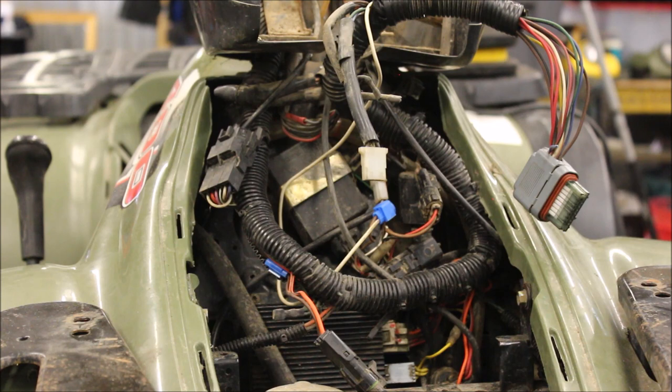Now you might be asking yourself — is this a good idea? The fan will stay running while the ATV is running, only on the key switch. As soon as you turn the key off, the fan will shut off. If you have an old Polaris and you want to save some money and don't really care, this is a way to bypass the ECM. If you want to do it right, spend the $260 to $300 on an ECM and put it in. I'm just showing you a little shortcut to save some money and keep your wheels running.